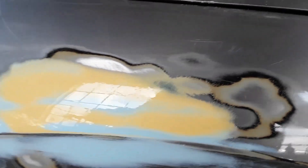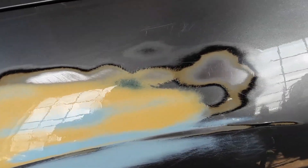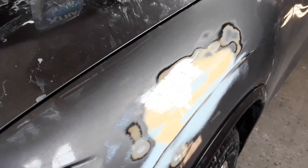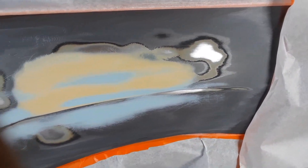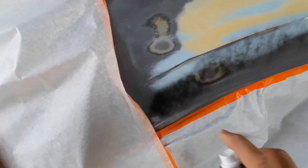You can see how far that little dent actually spread — it's bigger than what you think. She's ready for primer. Primer will be the last coat that really fills it and allows for feathering, so we're going to dry it off and prime it. For primer, we're going to hit it with some self-etching primer first, because parts are now made with galvanized metal and regular primer won't adhere to it. The self-etching primer creates a barrier on all the bare metal spots so it won't flake off.